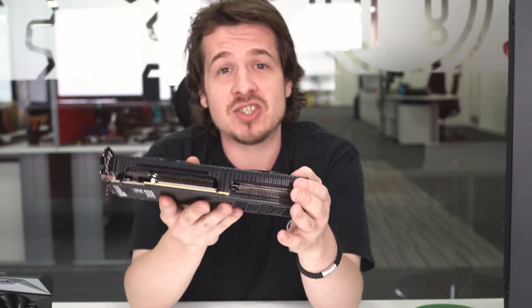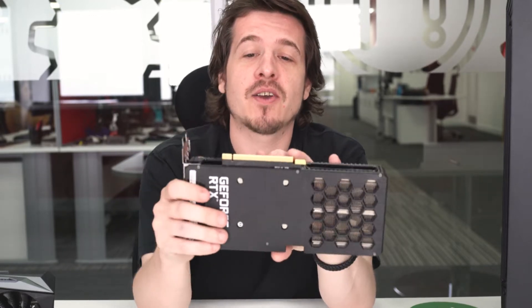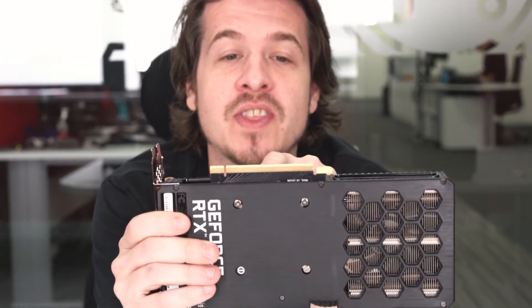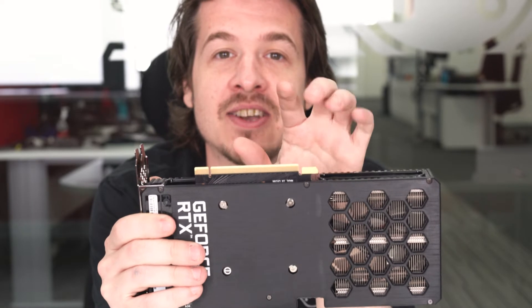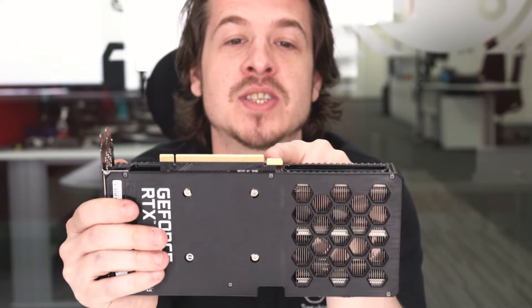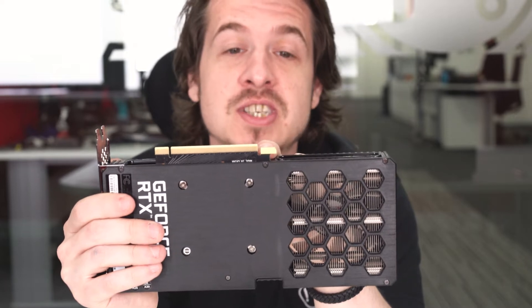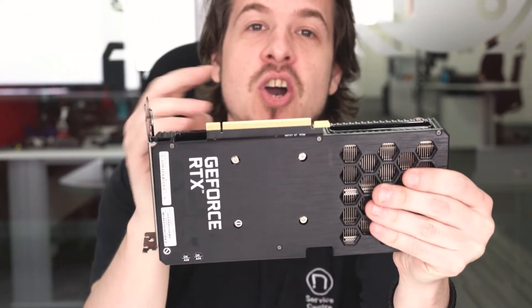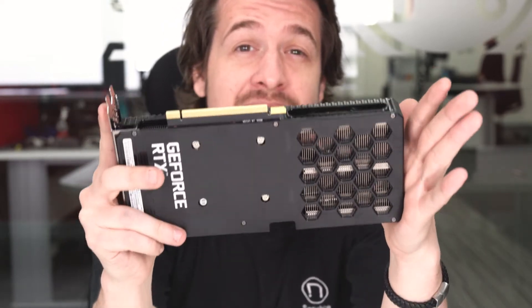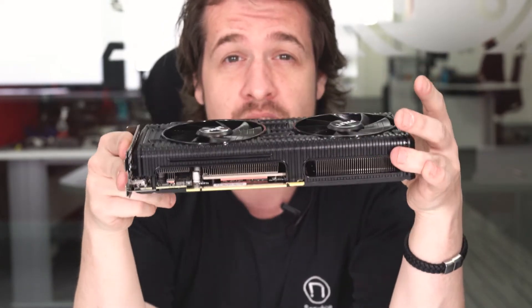In that instance, just be more careful. Do that before you fit the motherboard, because you don't want any metal components scratching on other metal components. Further down on the card, we have what we call the PCI interface — the part that allows the card to communicate with your system. And then the last part is what I like to call the retention foot. This is what goes under the little catch on the PCI slot, and it's really important that it stays secure so the card won't wiggle around, come out, or break.